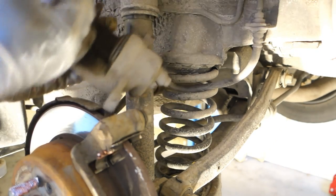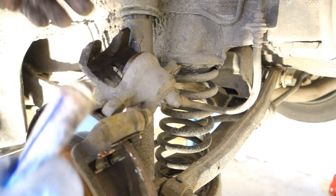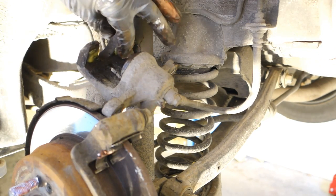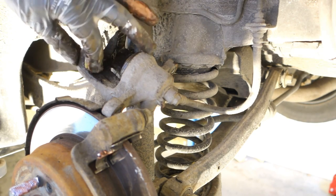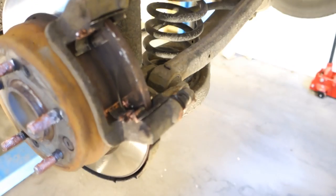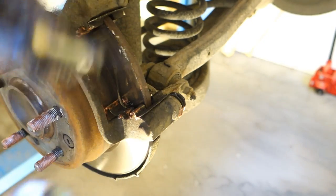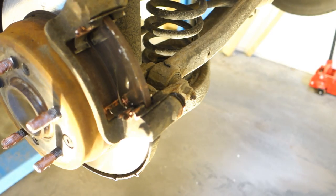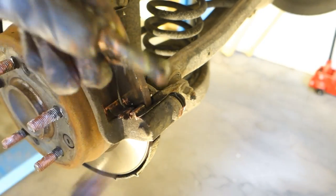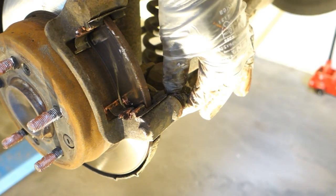And then this other area in here, inside, in that area, I put it first on my finger, and then I add it in here. And why do I add that in here? Because I like my brakes to be lubricated and always smooth, and these pastes and greases are all designed for the right position. And then also on that bolt, I add this brake lubricant in that amount, and then I use my finger and spread this lubricant in all areas. And then I know that this part in here is really flexible. And then I press that bolt down, and then it's ready to use for years.